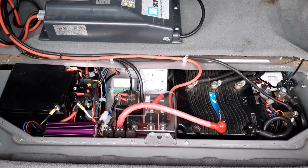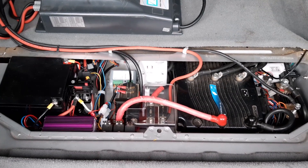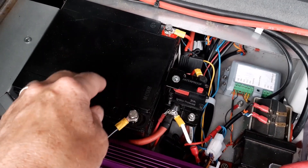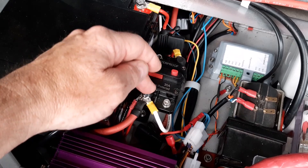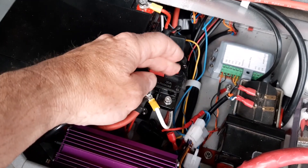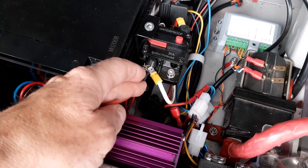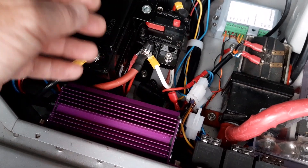In the back, all the control unit sits in the area where the old petrol engine used to be. I've used the access hole and made a tray that sits in there with everything bolted to it. This replaces the 12-volt battery that used to be in the front — it's a little bit smaller. More recently I've also put in a trip switch which lets me disconnect all power very easily — just press it and everything's disconnected — so I can work on things safely. That also takes power off to the front of the car for the main systems.